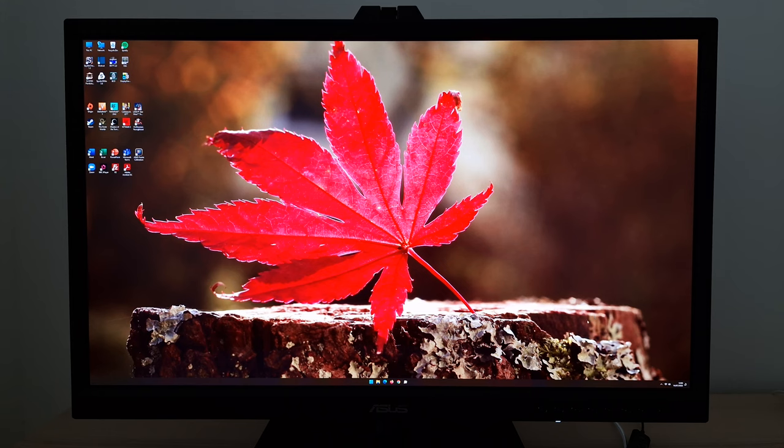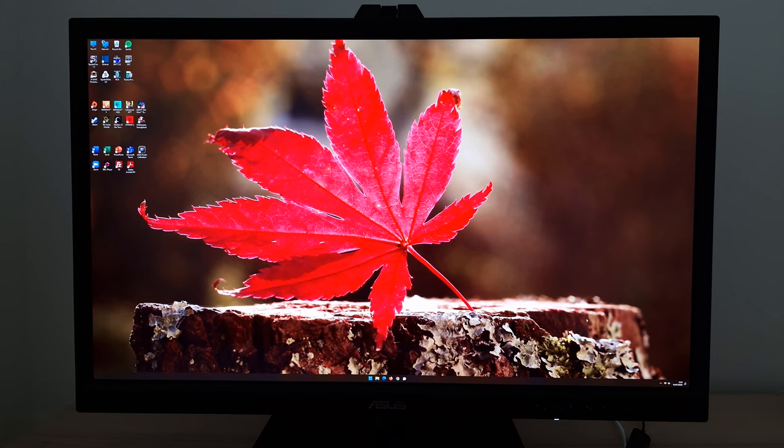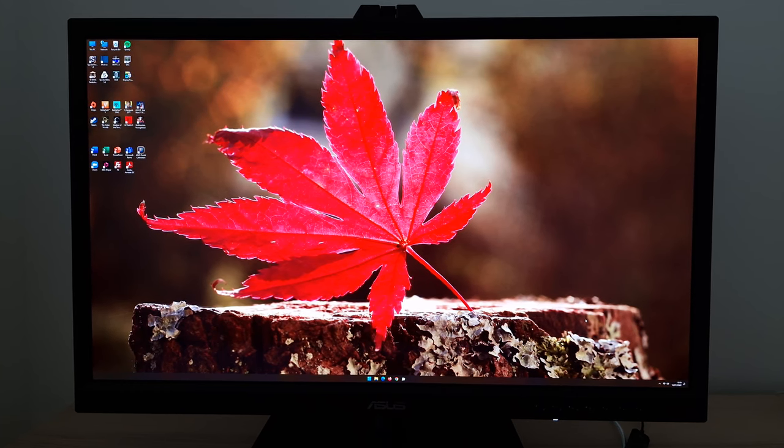For most shades, the colour consistency is exceptional, and the viewing angles as well, explored in the viewing angles video and a little bit in the written review, also excellent. Offers a very generous colour gamut as well. Really nice coverage of the DCI P3 colour space and Adobe RGB colour space, and of course the sRGB colour space. And it includes well-calibrated presets with all of those colour spaces in mind, and good flexibility there. And you can also hardware calibrate the monitor with the included colorimeter or your own colorimeter if it's a supported device there.